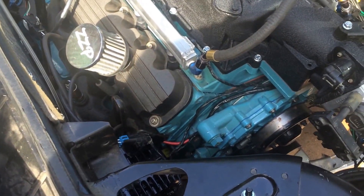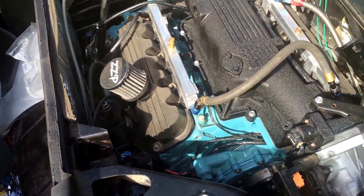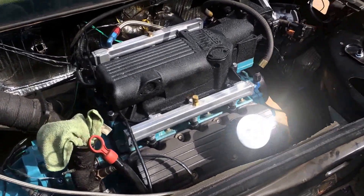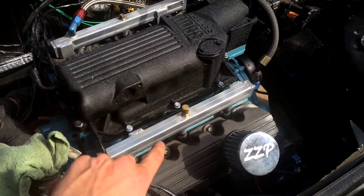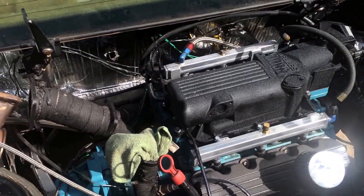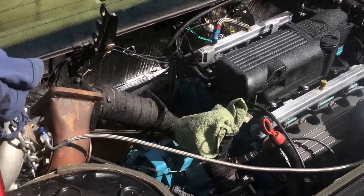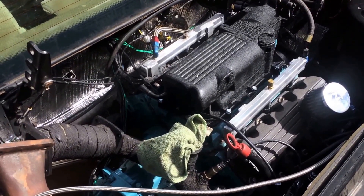I don't have an upper engine mount at the moment — it's in the garage and just bolts on normally for a very clean setup. You can see the ZZP oil breather. What I'm doing is running an exhaust scavenge setup — a hose comes out of that hole, drawing everything from inside the crankcase, and hooks into the exhaust. By the exhaust rushing past a pipe I place in it, it creates a venturi and actually sucks out the PCV system, burning everything instantly. Very clean setup.